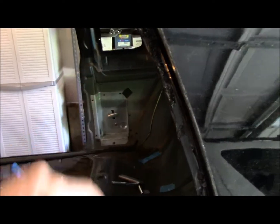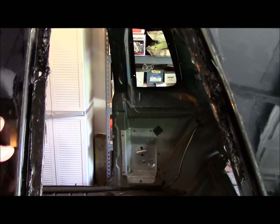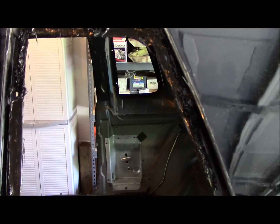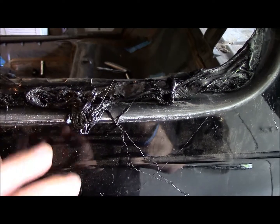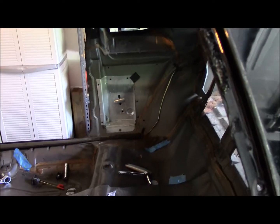I took out the quarter glass on both sides, actually pretty easy — I thought it was going to be more complicated, and it's the first time I've done that too. All it is is two studs on either side, one stud at the top, 10mm nuts on the inside. Take it loose, I just took a utility knife and dragged along the inside to kind of break up some of this goo and insulation that's on there, and then just applied even pressure to the studs one at a time.